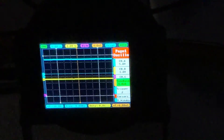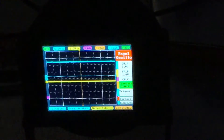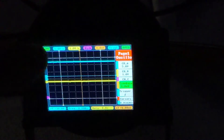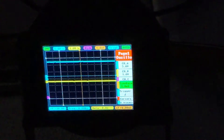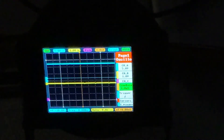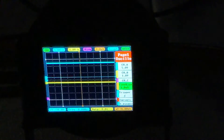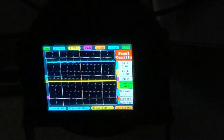So today we're checking this out on the digital storage scope and you can see the blue line up high — that's the 12.5 to 12.6 resting voltage. When I start the engine you're going to see a transition in that blue line showing the sag. It's DC and I'm not set up to capture it in microscopic detail, but you'll see it sag from the resting voltage and drop down — producing a little glitch on the screen.